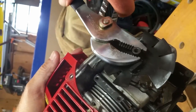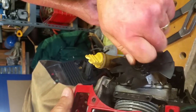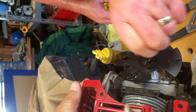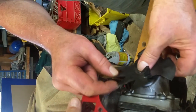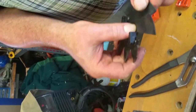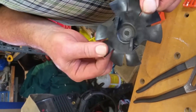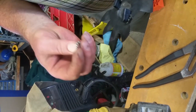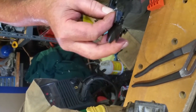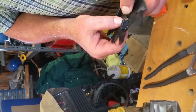Now with the piston movement held in place by the clothesline, get yourself a pair of vice grips or channel locks and start turning counterclockwise, as my friend here is demonstrating. We've already pre-loosened this one, but as you'll see, the top part of this shaft unthreads. There you have it. Now you can remove the fan assembly and the crappy little star lock washer that Sears put on. We're going to replace that with a new, better spring-loaded lock washer, reassemble, and hopefully the problem is cured for five cents.